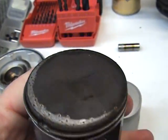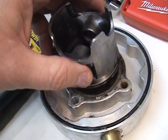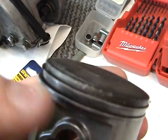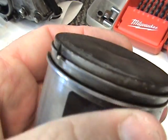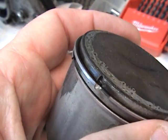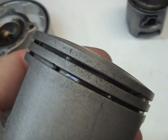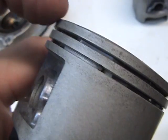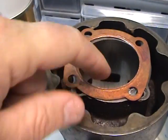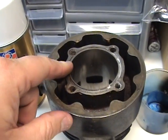What happens is we get to the top of the cylinder, the piston fires off — bang. The flame and the explosion travel down this edge right here, and they don't hit the top of the ring and stay there. What they do is get under the ring and into this groove — the explosion itself — and that pushes the ring out and holds it against the cylinder bore, because there's a tremendous amount of energy being released in that explosion.